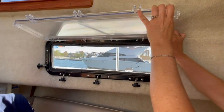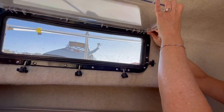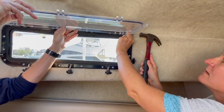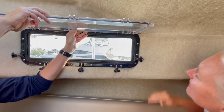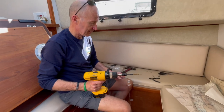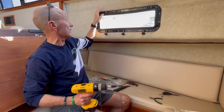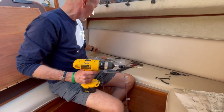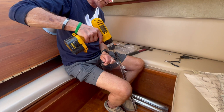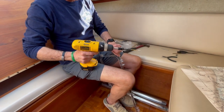What I found most helpful is to get the pin as far in as you can. We made a little modification — this pin was jamming when we tried to put it, we couldn't get it to go all the way through. The harder you beat on it, the better chance you have of breaking one of these tabs off, and then you're toast. We tried the old pin and it fit very freely, where this one was just getting stuck. So by drilling it out just a little bit, it goes in a lot easier.